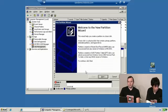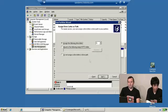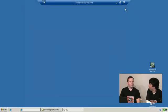So we'll create a new partition, but you can see it's 20 gig. We'll give that an I, for iSCSI, shall we? I want a small I there, Mark. So there we go, we're formatting the drive, and it says it's ready. So not your typical server, you don't normally present iSCSI and Fibre Channel to the same server. Well, I suppose it could do, couldn't it? That's what it can do, really.